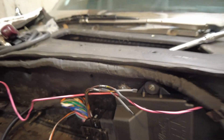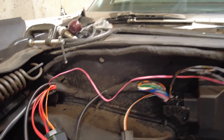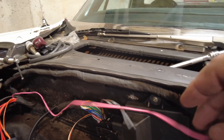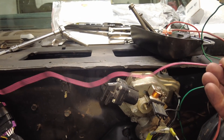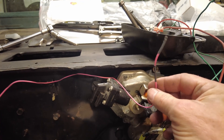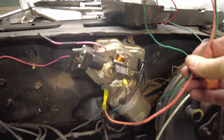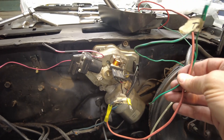Right now our fans are operated on just a temperature sensor that goes right in the fins of the radiator. Then last but not least, this is one of the wires we have to take care of — a black and pink wire which goes all the way across here. That is actually the wire that enables the whole system, so it needs to go to the ignition switch. That is all of this wiring here which ran the old ignition system, and we'll be probably getting rid of a bunch of that and tapping into it for what we need.